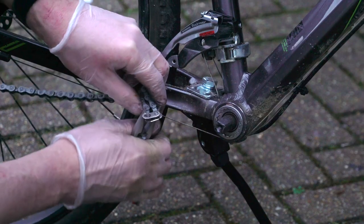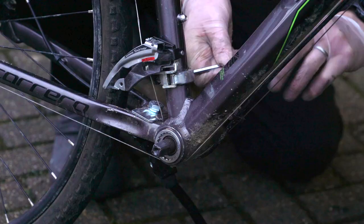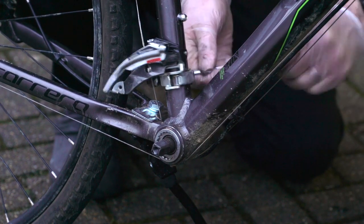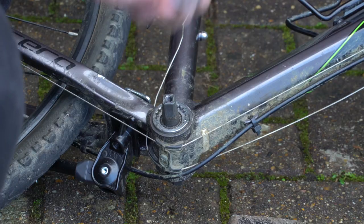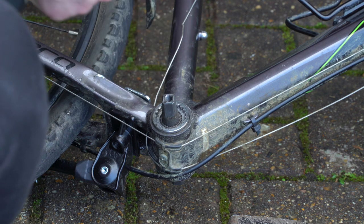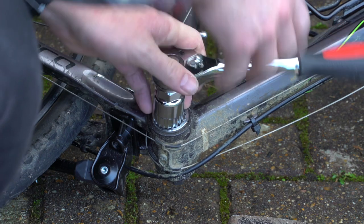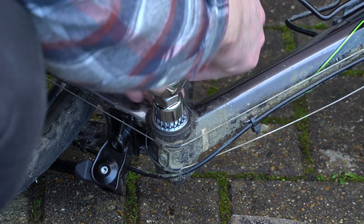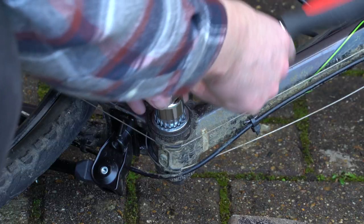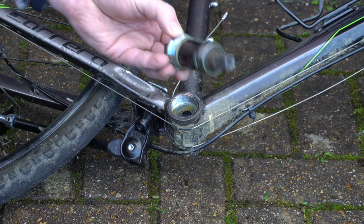Because I had to remove the derailleur, I thought it was worth disconnecting the chain — fortunately this chain had a quick release link on it. There's another specialist tool here for removing the bottom bracket, which I'll link in the description. This is a reverse thread, so I'm putting it in what feels like the wrong direction. Again, a bit of percussive persuasion was required, and we won't be needing the old bottom bracket anymore.